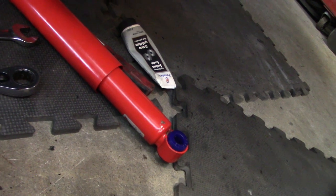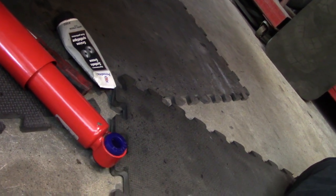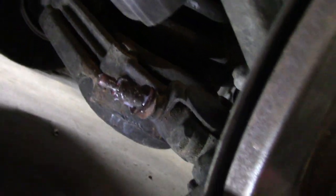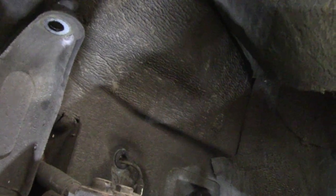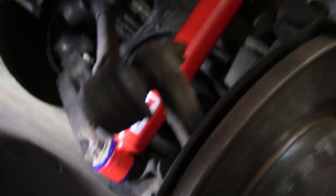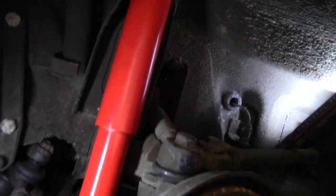I've changed my mind and decided to go with the Super Pro poly bushings - once I started playing with the stock bushings they seemed more like rubber than poly. We've got the Super Pro synthetic grease supplied in the poly bushing kit. Going to put the bottom mount on and fit it loosely at the top. Quick look at the first shock installed: washer, lock nut and nut tightened at the bottom; two nuts tightened up top; bushings not overly compressed.